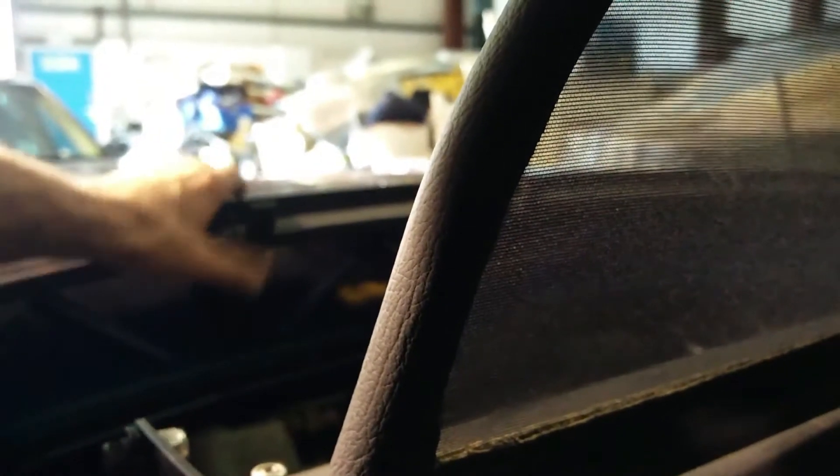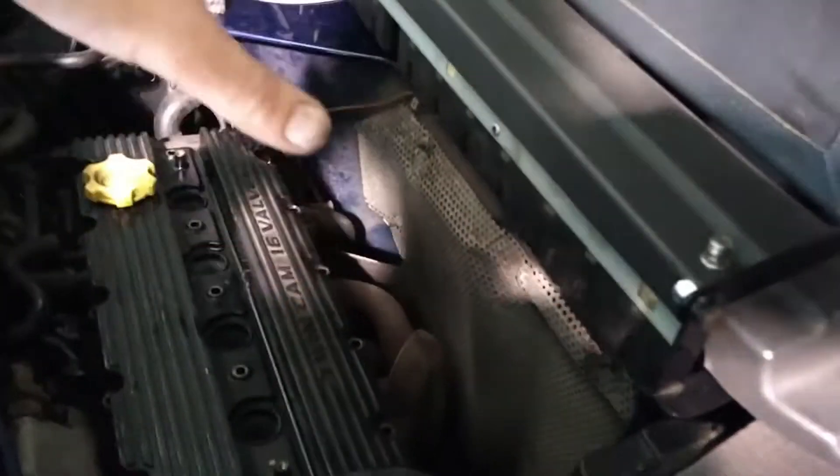To do your head gasket on one of these, go in behind the seats through here and you'll see these little toggles that hold the roof. Just clip those. Once you can clip those, there's a carpet in here. Take the carpet out of the way and then you've got a metal shield. There's the metal shield — it's got 10mm headed screws holding it on.